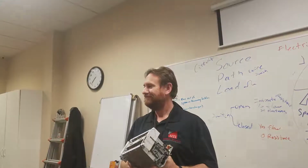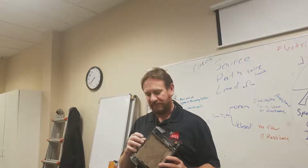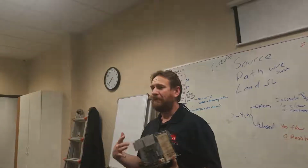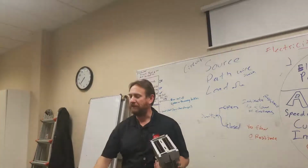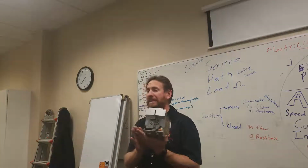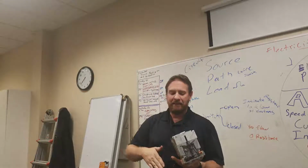So how does it know when to pop up? Oh, that's a good point. So it has a point that says one slice. When you put the bread in, there's a little piece of metal. It's called a bimetal. We'll get there later. But a bimetal, when you get it warm, it starts to heat up and it starts to warp. It starts to bend. There's two pieces of metal, two different metals. One metal will warp faster than the other metal. So when I heat the metal up, one metal bends a lot. The other metal bends slowly. And it starts to warp.